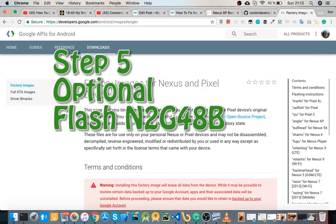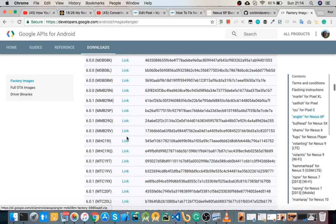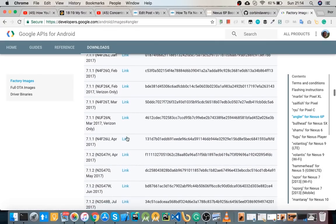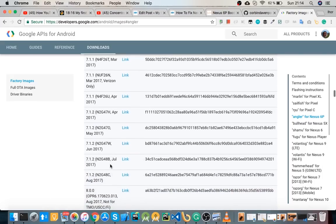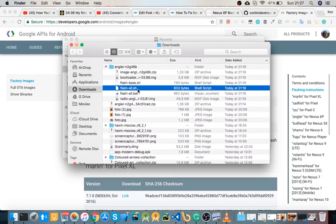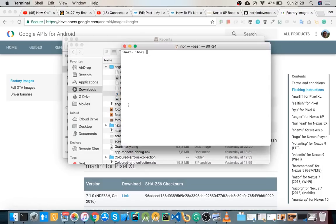Now go to this link, factory images for Nexus and Pixel devices. I'm gonna link it in the description. And you see here factory images. Go to Nexus 6P and look for this version that I mentioned before, N2G48B. You see here, download it. Now once downloaded, open the folder and run either flash-all.sh or .bat depending on whether you're on Mac or Windows, like this.